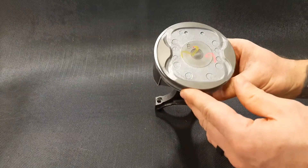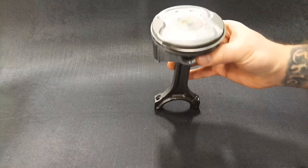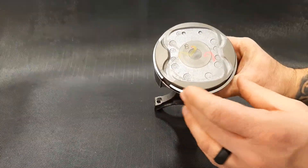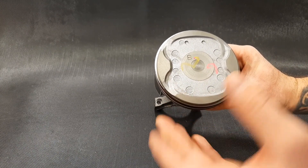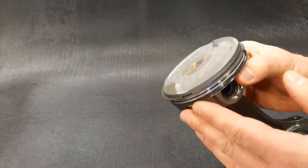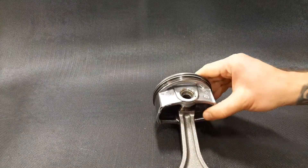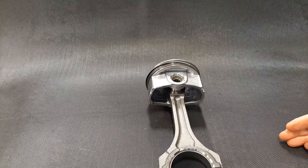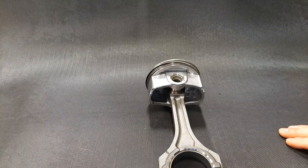Getting on to the inspection — the first thing we're going to do is look for carbon. When we take these out of the engine, any carbon that's there is going to have to be cleaned off. Carbon on the top of the piston and around the top ring is totally normal, but we will have to remove it before we put it back into service. If it's totally covered in carbon we won't be able to see anything. The best way to clean it is with a solvent, which is not going to damage the piston — no sanding or scraping needed.